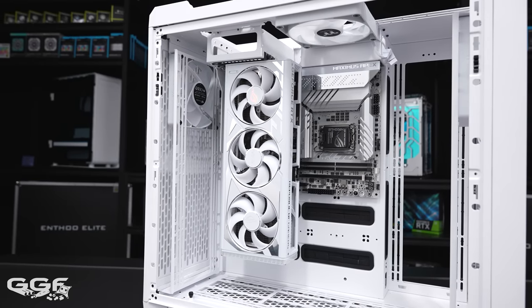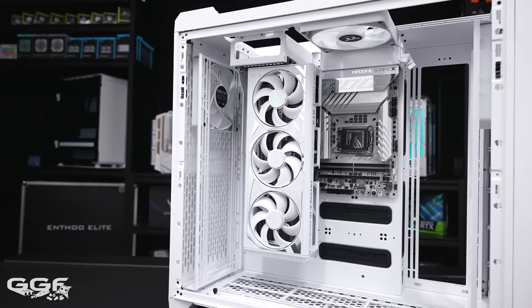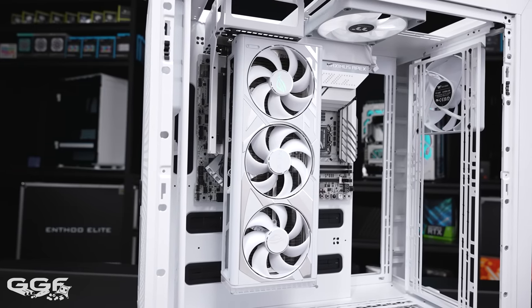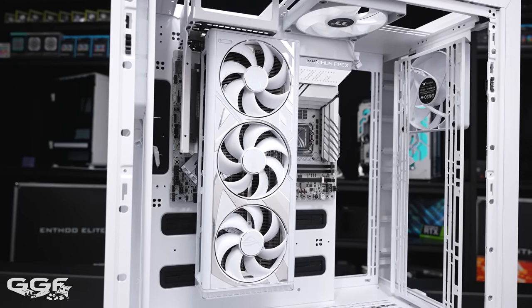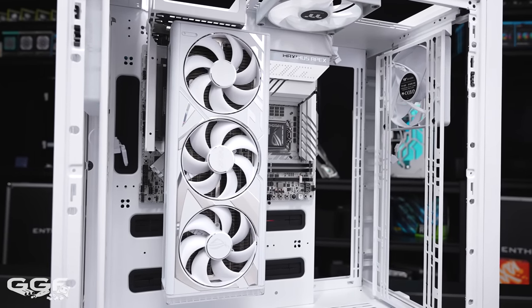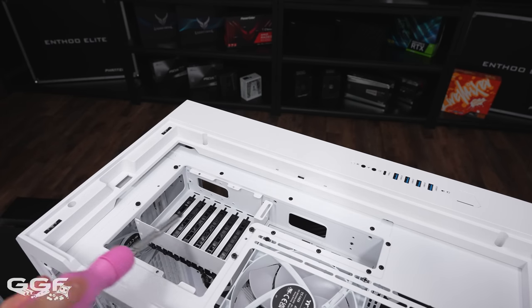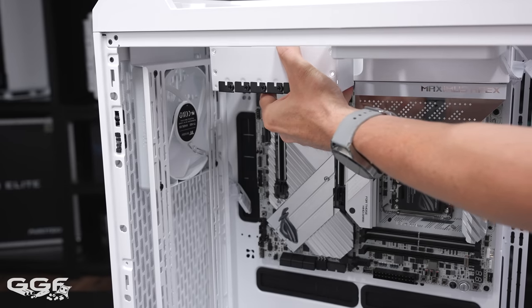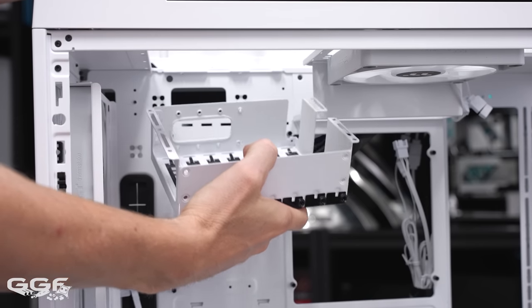Vertical GPU can also be found in the chassis. Technically, the GPU is already vertical due to the rotated layout, but in a traditional case layout, the CTE 750 offers what we would call a vertical GPU bracket, but in this scenario, it simply rotates the GPU so we can see the complete fan side of the GPU. To go down this route, the PCI module needs to be unscrewed by 4 screws and dropped down to remove. One thing to note here is the PCI module can only be removed without a motherboard installed in the chassis.